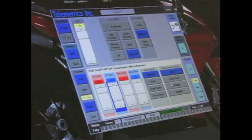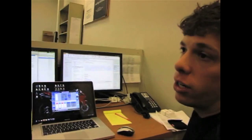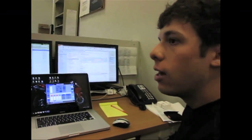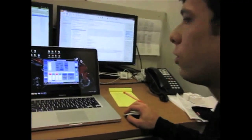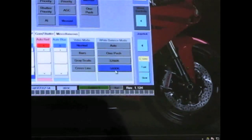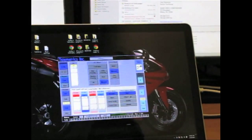If you have different lighting on different days — maybe morning lighting is a little different and afternoon gets brighter — you can store those in scene files. Scene file one for the morning, scene file two for the afternoon. The 3200K and 5800K are built-in white balance modes — 3200K is a little more blue, 5800K is a little more red, referring to color temperature in Kelvin. You'll probably operate in auto or one-push most of the time.